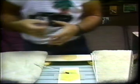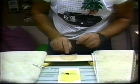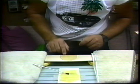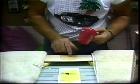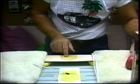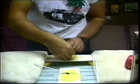Drop the cloth right in. Now you can see, if you just do a little pat with your finger, you can move it around a little bit, kind of line up the little dots if you can. You've got one layer on there, and because it's a little warm, a little bit of heat will just soak it right up. Now as you apply the heat, you'll notice that if you sight your center line, you're going to lose your center line a little bit at a time. Get the second piece. This is why you want to have all your glass cut ahead of time. Drop that right in. Pat it down with your fingers.